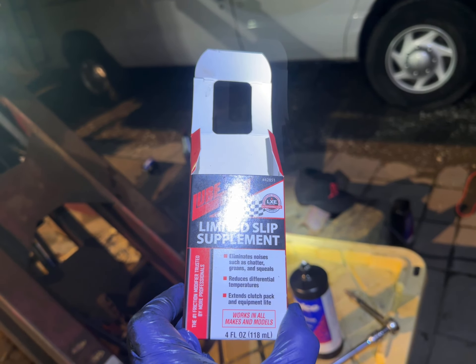The front differential or axle takes 1.75 quarts. Take off the skid plate with 15 millimeters. Take the top bolt off first, which is a 15mm, then take the bottom one which is a 13mm. Let it drain — probably do this over a day or half a day, just let it sit. Then use this pump tool to fill it. I ended up just removing this, going straight in, cutting a bottle up, and pumping it like that.